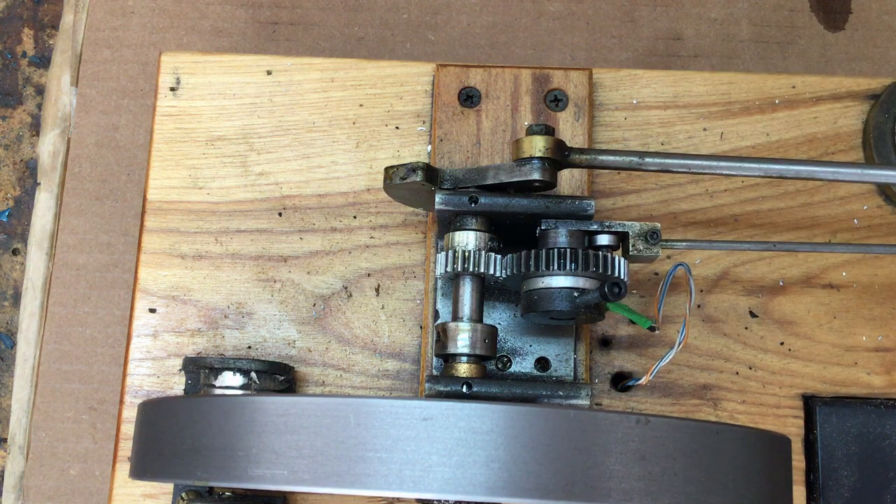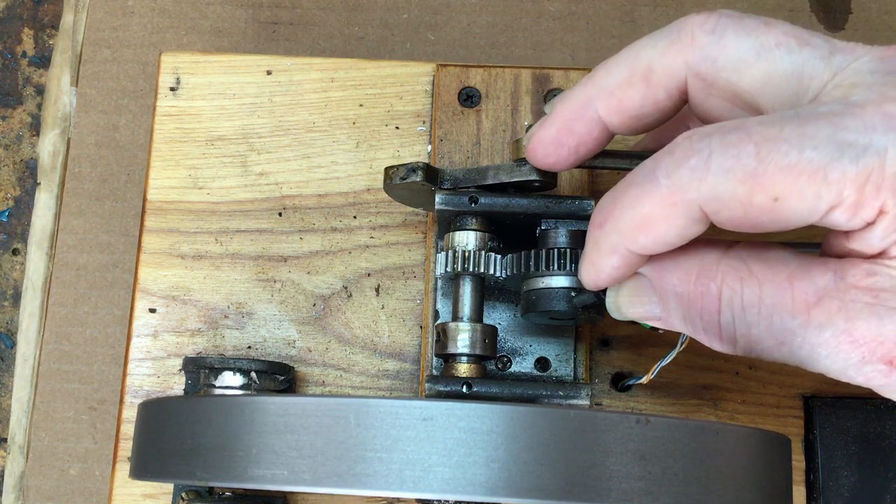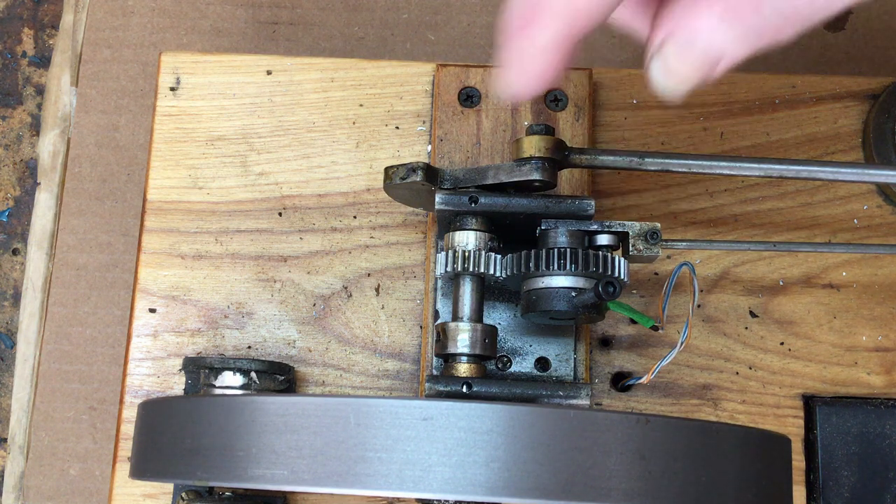I actually think it's better to run it so that it fires a little bit either on or past dead center, which would be considered slow timing. But the whole objective of this engine is to run pretty slow, so that's the reason I like to run it retarded.